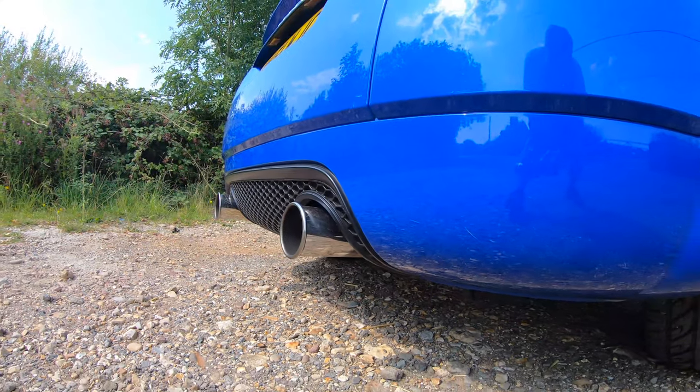I recommend getting a new gasket for the turbo. It's less than a tenner for a genuine downpipe gasket to go between the turbo and the downpipe. You can buy them anywhere. I'll put the part number down in the description. I got mine from Coverdale Car Parts. Came really quickly. The downpipe and cat pipe or decat pipe, depending on what you get, also comes with a gasket from Pipewerx if you buy there, so that's already covered. And then it will couple up to a standard system or a performance system of your choice.